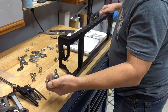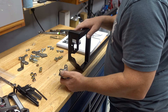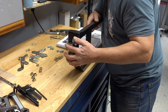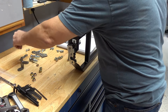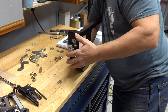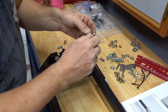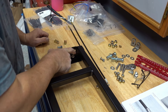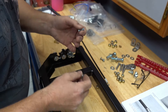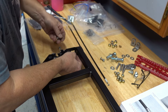Alright guys, next part is to just get the door frame and put the striker plate onto it. This should be the left door frame, and then this kind of just fits in to here. Put these on here with a washer. Next thing we need to do is attach the clevis here to this part of the bracket. Here's the lever. I'm using just a — oh, my hands are dirty — screw in a lock nut, lock washer. Let's see if I can do this without too much trouble.